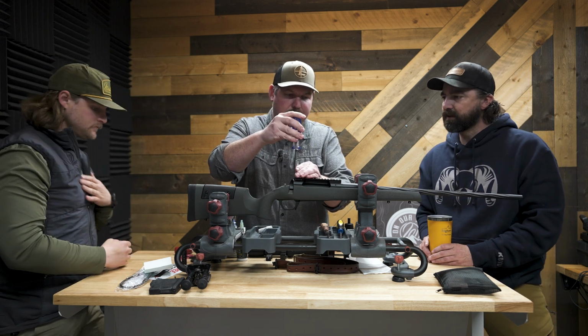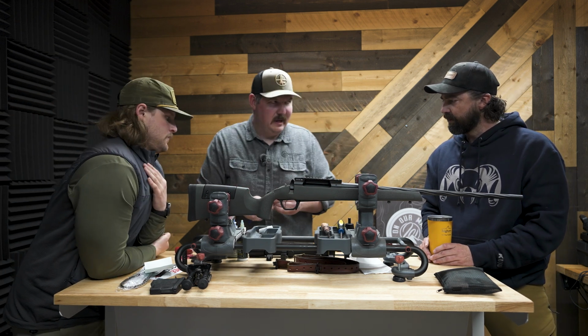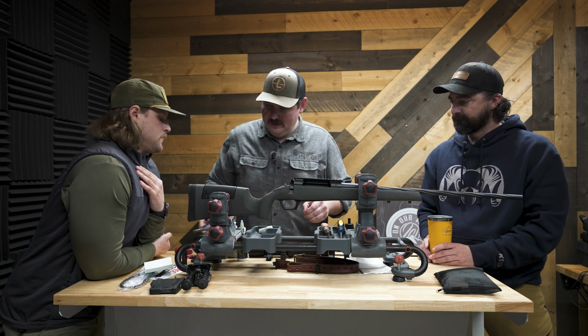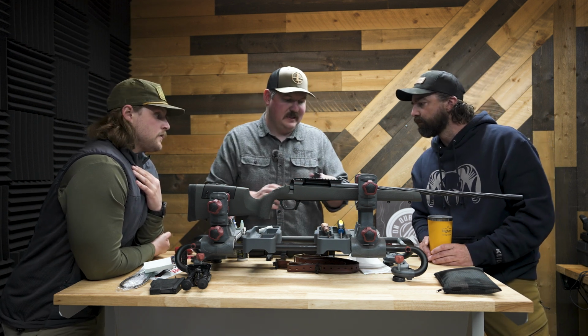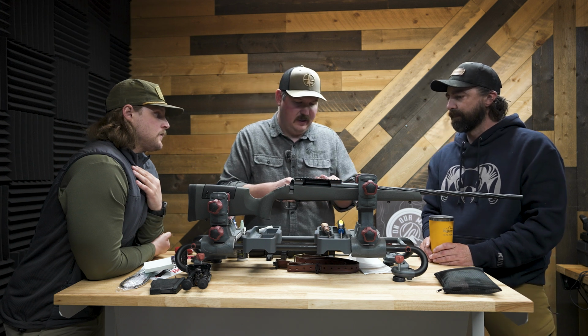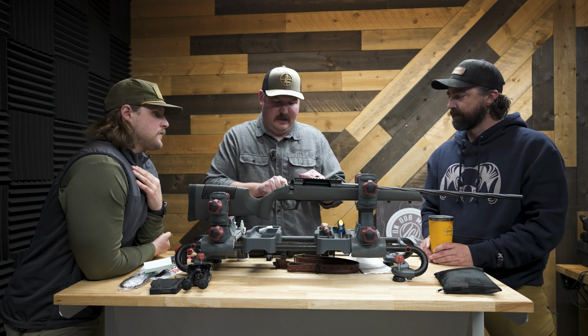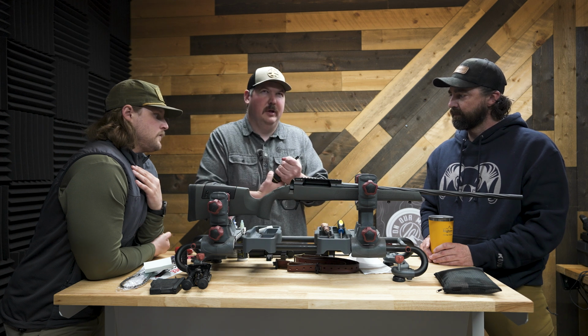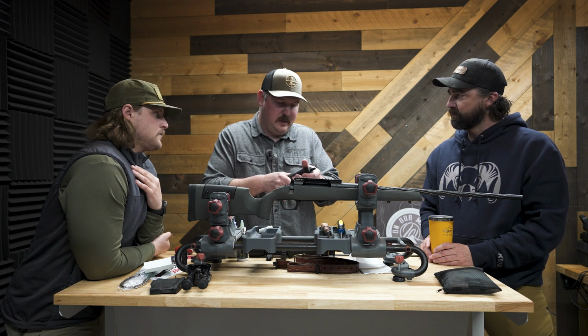So in that J-rail kit, did it come with a bit? It does. It comes with a bit, so you're good to go on that. That's a T20 or so? This is a T10 actually. T10, so yeah. And then I think it actually comes with one extra screw too. And the torque spec on this is about 20 inch-pounds.